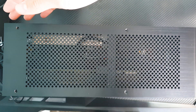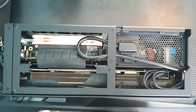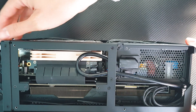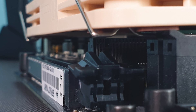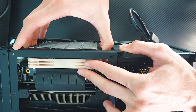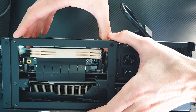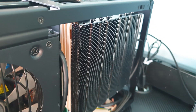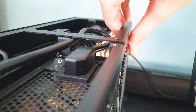If you want to use the 120mm fan, the best one I found is the Noctua A12x15. Besides the VLP RAM, you'll need to sandwich the fan between the PCIe riser and the heatsink. At first I thought I'd never make it work since the fan is almost directly over the PCIe slot. Basically you pull the heatsink a bit to the outside and slide the fan in from the top. With some patience you can mount back the wire clips, and it will never move even at 100% RPM. The heatsink will stick out a bit but the side panel will still close.